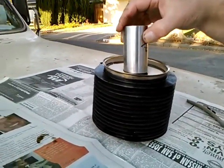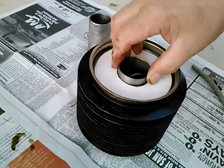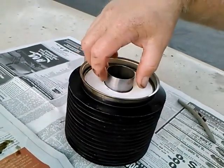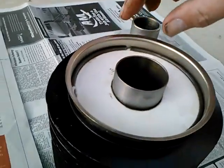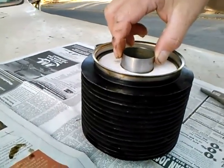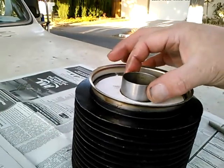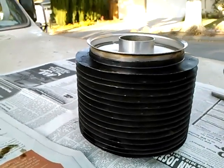When I put the canister back on the mount, it's going to go over the spacer just like that. We'll see in 3,000 miles if I get a good imprint of the screen on here — if the fence has bitten into the paper. Those two things will indicate a good fit and a minimum of bypassing this bypass filter. If you have any questions, be sure to leave a comment, and be sure to watch my other videos. You can see how this is reinstalled in my other videos.